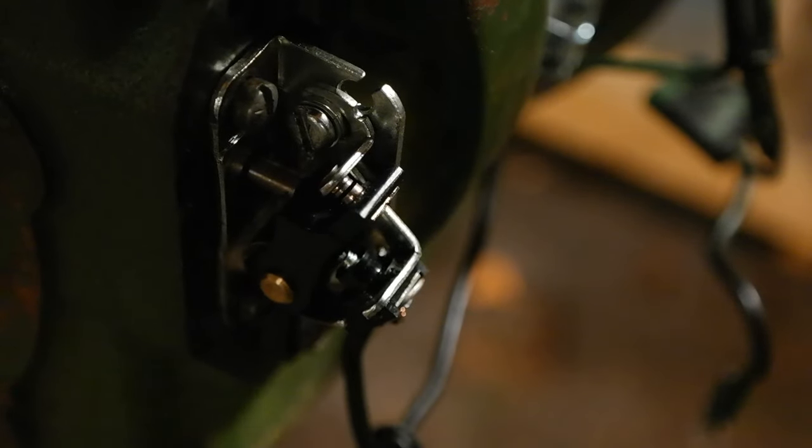If your points wear to where cleaning doesn't help your ignition system, I recommend replacing the entire point system and setting the gap properly to .020 of an inch. And there you have it — that's all it takes to set the gap setting on your points for your Kohler K engine. Please subscribe to our channel for more awesome videos on Kohler K engines as well as vintage garden tractors. Also check out our website at isavetractors.com — we sell every part to restore your Kohler K engine as well as most vintage garden tractors. Thank you for saving the tractors.